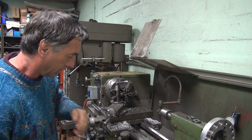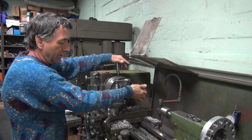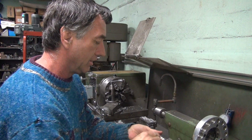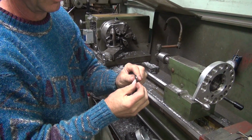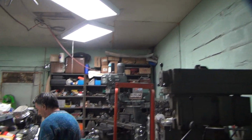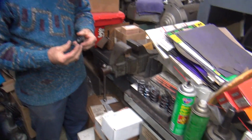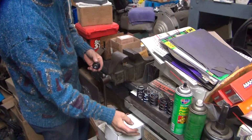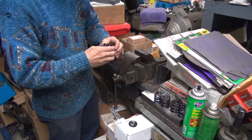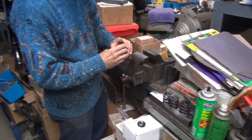If I had my sweatshirt on there, it wouldn't stick so bad. This is a chip magnet. Every chip in the world sticks to it. Alright, those are definitely really thin. Alright, hit full stroke. So that means your valves can be even higher than normal, probably. We'll see. So we're going to measure the height between here and here.